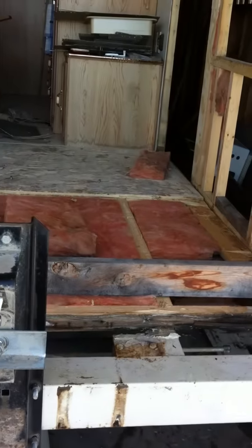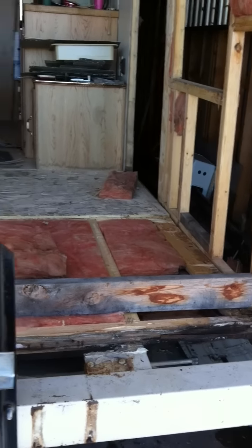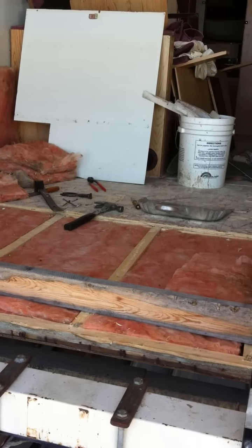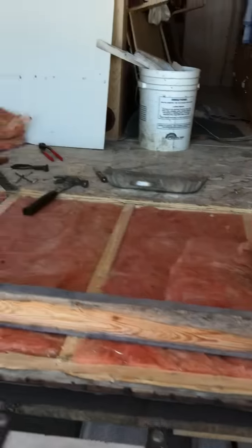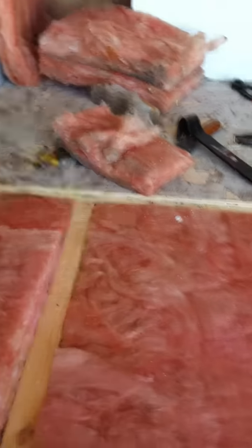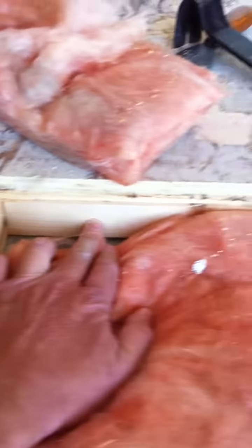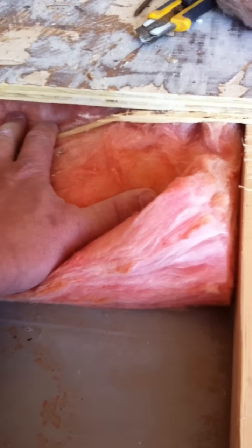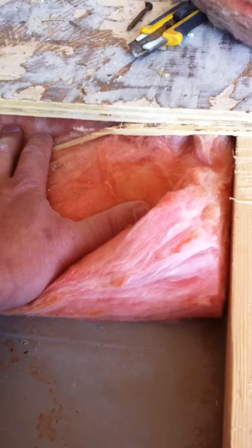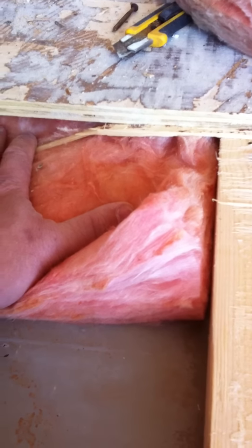But I don't know how much it really improves things, especially since the rear wall, once it's back in place, will strengthen the framing of the trailer in the back quite a bit. It is really perplexing how these floors are laid out. In the back, where there are two-by-two cross pieces in between, back here there are none. So there is really no load-carrying aspect to that floor at all.